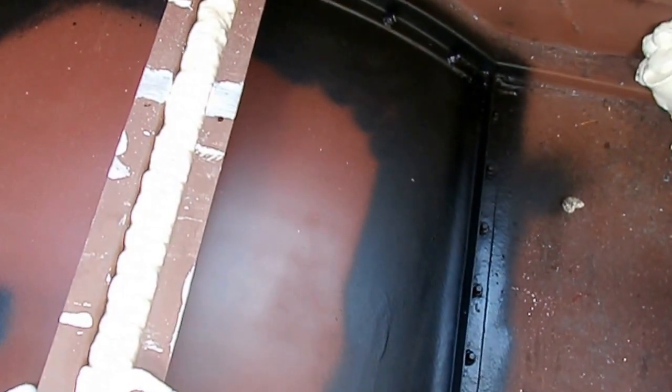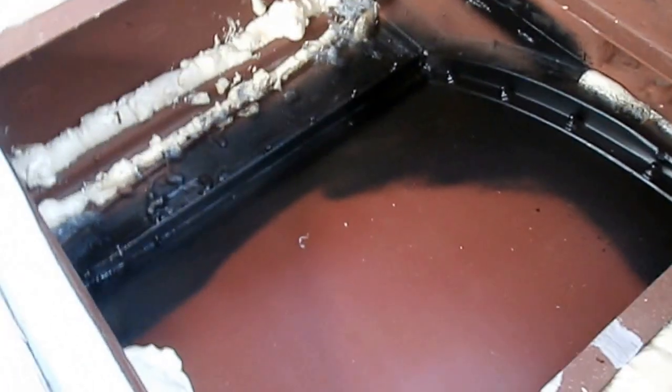So what's happening is we got the wheel wells done. I'll show you these back wheel wells. These guys right here, piece of metal in the center. So this guy right here had to be done on all four wheels. It's a piece of metal that's bent over and held down along the perimeter here, all the way along the perimeter. And you have to go underneath, take the tire off, pull down the fiberglass wheel well, and then pull the old one out and put this one in. The other ones were so badly rusted that they weren't attached along these edges anymore. So they had to come out.